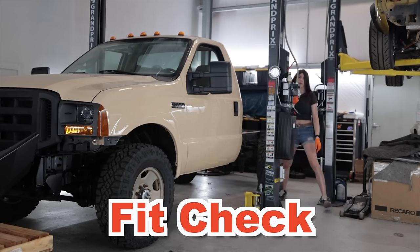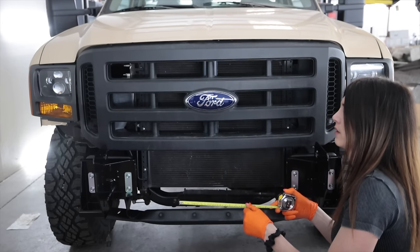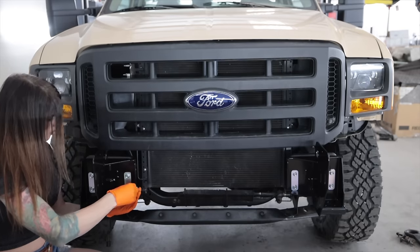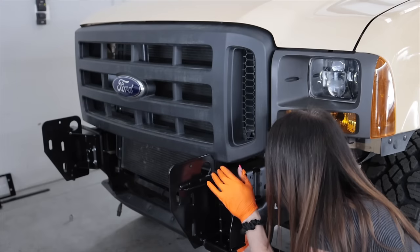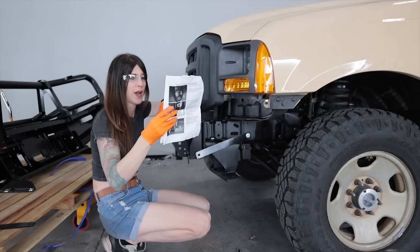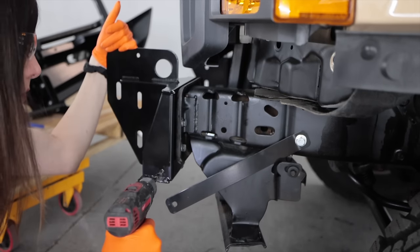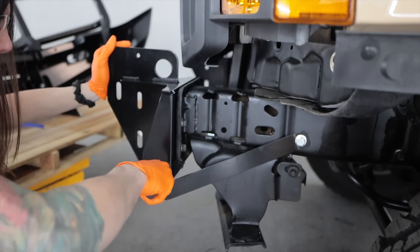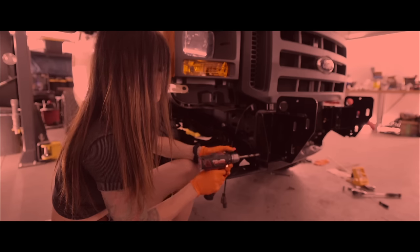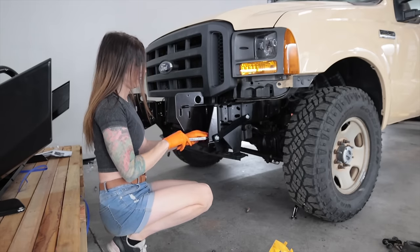I got a metric tape measure. 953 millimeters centered. The answer to your question is 476.5 — 476.5 should be the center of the Ford logo. Well that was a juicy bug. Oh, it's already notched for it — that's interesting. Drill through strap and bracket at the same time. That's still perfect. A little bit of paint marker. I feel like this little tension strap was a little bit of a lazy design — it gets the job done, but eh.